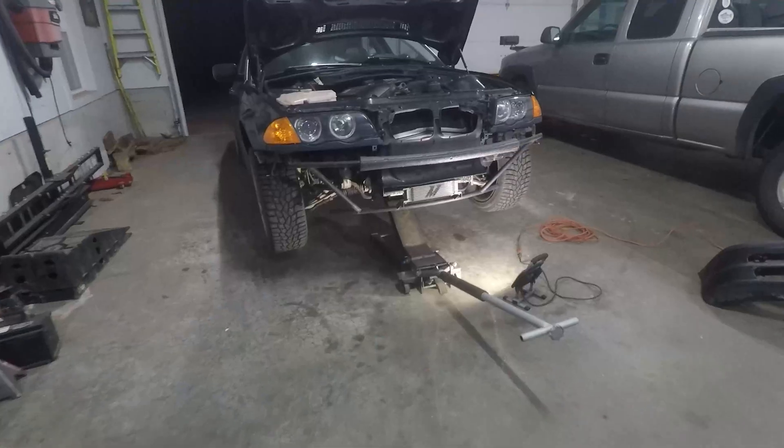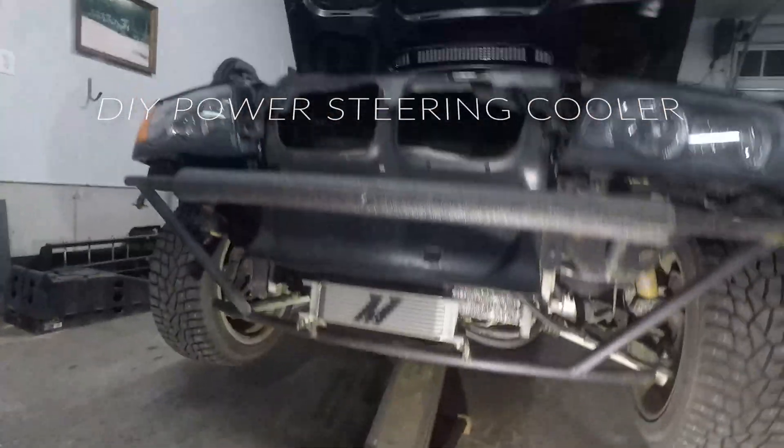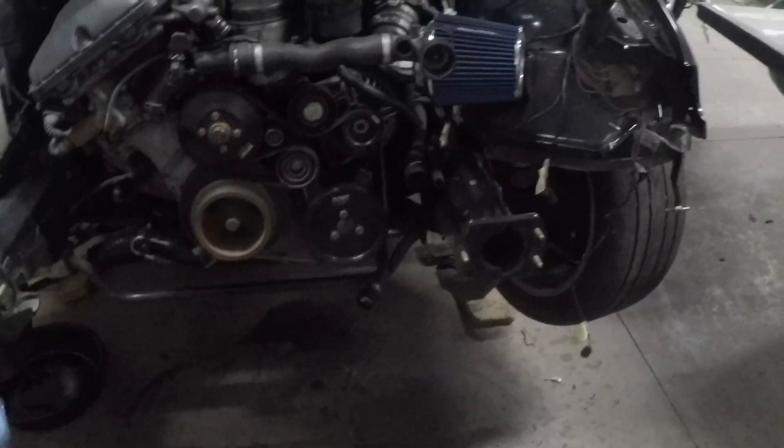I'm not using it necessarily for oil, but I am using it for a fluid that gets hot — it's for power steering fluid. It does way more cooling than the factory cooling coil. The factory cooling coil is literally one loop with no cooling fins, and there's no great way of cooling the power steering pump for stock driving use. Since I'm gonna be drifting this car, I want as much cooling as possible for that power steering rack and pump, because that's one of the first things you burn up — a rack or power steering pump getting overheated. So one of my ways to combat that is to install a cooler.